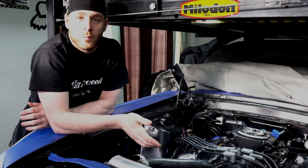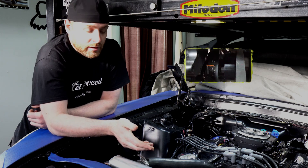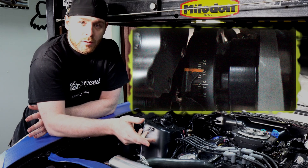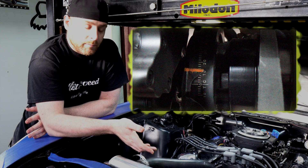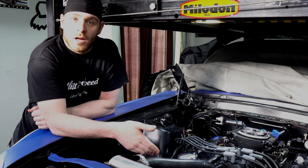The first thing we need to do is set our crank. We know that most motors run well between 12 and 16 degrees for your initial timing setting, so we set ours to 14 — I always split the difference and start there. We can always fine tune afterward, but it should fire up and run no problem. Once our crank is set at 14 degrees before top dead center, we'll make sure the cap and rotor are facing the right direction.